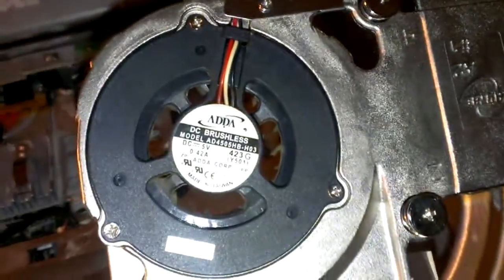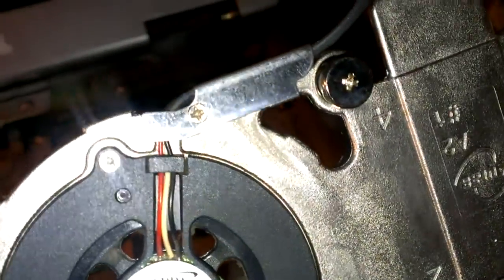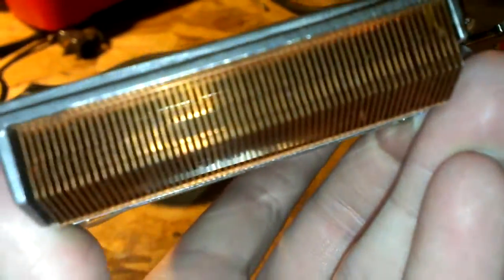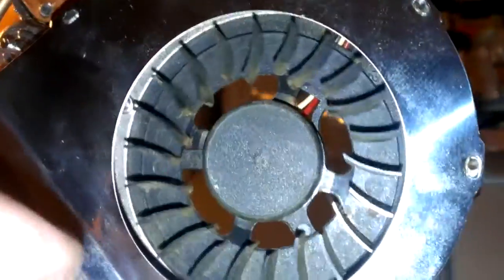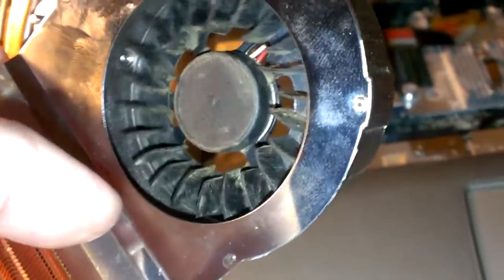Right here is your fan. Take them three little bolts out and also that little one up there that holds the wire, like a little bracket. Take that out and then on the inside you'll see your clog. This one's already clean and good to go, but take that fan out and then clean on the inside there, right down in there. It was just full of lint and dust and it was just completely clogged. I got this fan as clean as I can get it with a Q-tip.